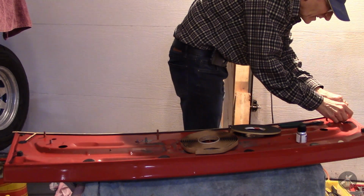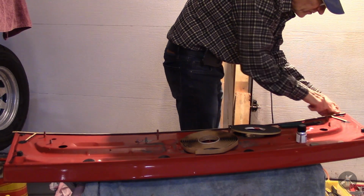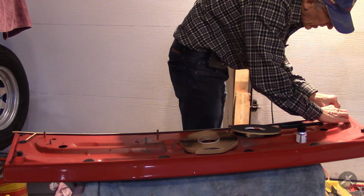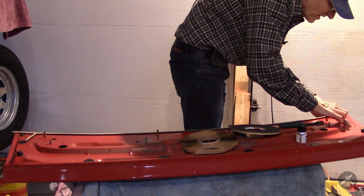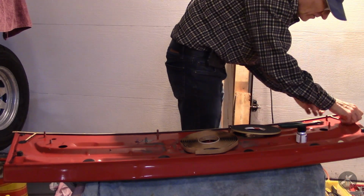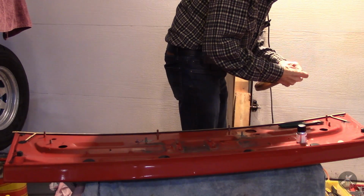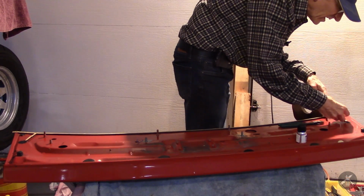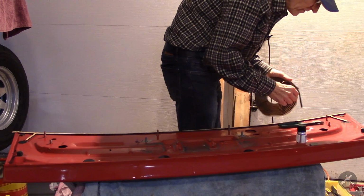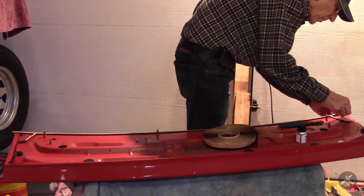So we'll put this guy down in here, because the instructions are to put the foam tape down first, put the butyl down second, get them all lined up, and then apply the urethane primer and urethane. Alright, so that's about right. Set that to the side. Here's the, okay, and that'll drop right in there. My little marks are still visible, so before I install that, let's go ahead and pull the paper off.